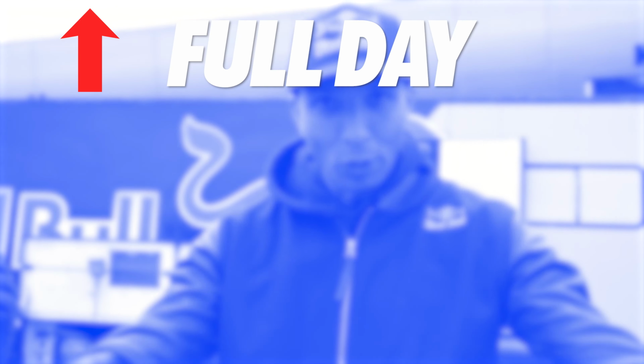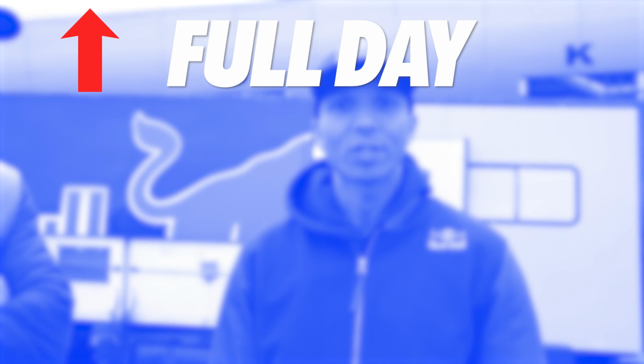New engine needs to be softly warmed up, right? Exactly. The main thing on these very modern engines is actually, in quotes, only the bearings. They need to bed in a little bit. They need to know what's on the other side a little bit. We need to drive the cars on a specific RPM with a specific torque for a specific amount of time. And in old engines and forged engines, this could take up to a full day. With those modern engines, we can really compress it down into a couple of hours. But it's still important because you don't want to mess up those new engines. Exactly. So let's go.